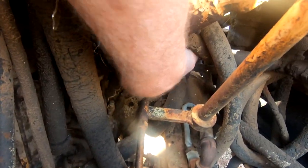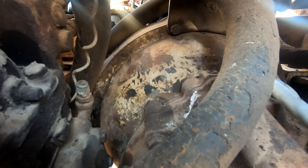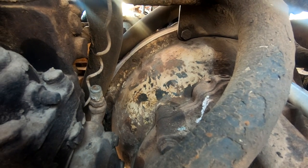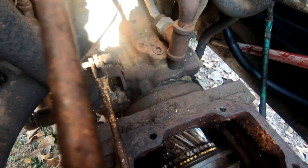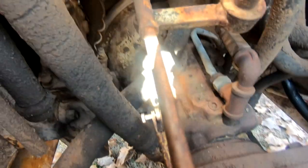Forward of that, in that sort of rounded bell-shaped housing back there - it's called a bell housing - that area is the torque converter. That's like an oil-operated clutch, and that's what gives you your automatic transmission function. I want to pull this gearbox off because we're unable to move it now with the rust. I want to start the engine and see if I can get the drivetrain to turn at all while the engine's running. That'll tell me whether I have any problems in this forward part or whether it would probably be okay to proceed with repairs on the gearbox.